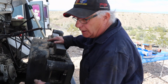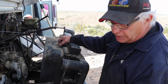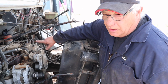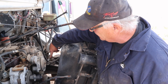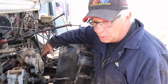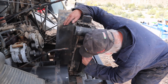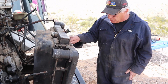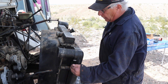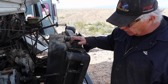We got this back into place and we're not going to tighten it down yet because you've got to put the fan on first — you can't pull this out without taking the fan off. Always line your bolts up on your fans at 12 o'clock so you can line them up at 12, 3, 6, and 9. That way you know where the bolts are and you can put the fan in without fumbling. Also when you get the rad out, look through and check for bugs between the rad and the engine.